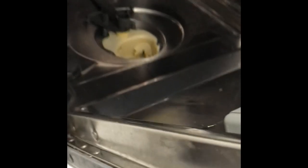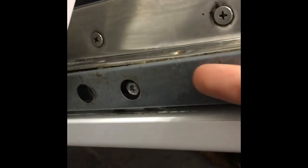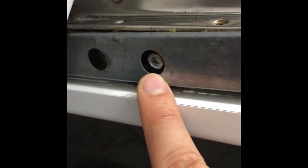Once you've ensured that the reservoir at the bottom is as dry as you can get it and the dishwasher is off, the next step is to remove the door. Lift the door to such an angle where the screw will now be visible from the side. This side port will sometimes have a cover which will just need to pop off with your finger or a screwdriver. Unscrew both sides and then removing the door is as simple as pulling it up and sliding it off the rails.